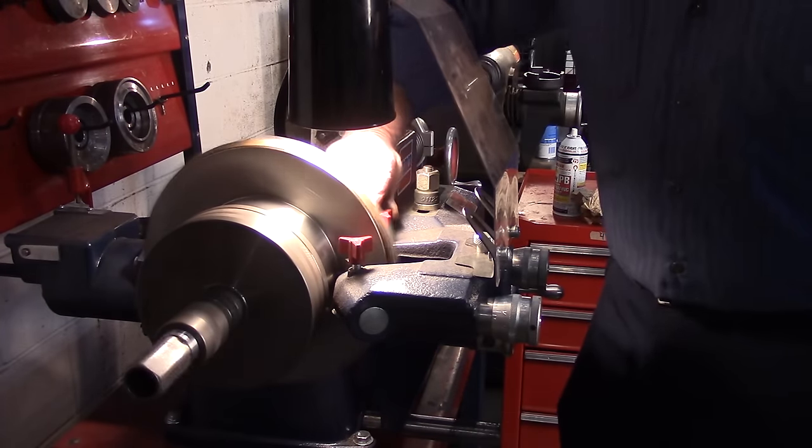We've completed our second cut. I'll put the feed lever in neutral, shut it down, and check the work — nice and smooth, everything looks good, no noises or anomalies while cutting. Before I take it off, I'm going to take another measurement with the micrometer to confirm we stayed within specifications. Simple math tells us we've taken about ten thousandths off total, so we should have about 55 thousandths left. My reading is about 938 to 940 thousandths — easily within specifications, with plenty of room left on this rotor.